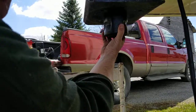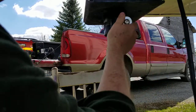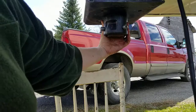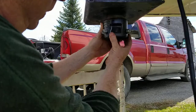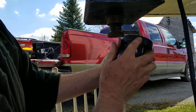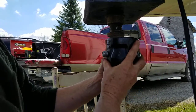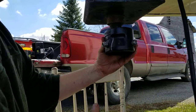Next step is to take this adapter off, or in your case to put it on. You need an Allen key — pretty straightforward. Once you get those Allen keys backed off far enough, it drops right off, and there you are back to your original pin. This adapter does say 'top front' on it — you've got to have that obviously pointing forward, so your whole hitch assembly is going to be in line when you're ready to go.